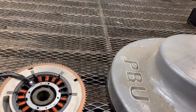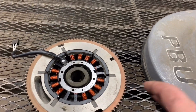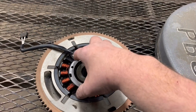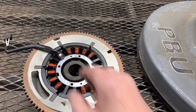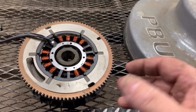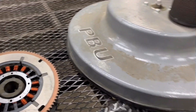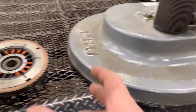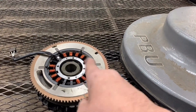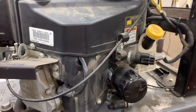One of the common mistakes I see is when people's engine is not running correctly or has no spark, they'll replace the stator thinking it's what makes the engine spark. I can see where that could get confusing because an outboard motor has a stator that utilizes both the charging system and the ignition system. But on a small engine, the stator has absolutely nothing to do with ignition.